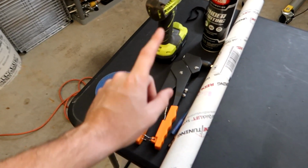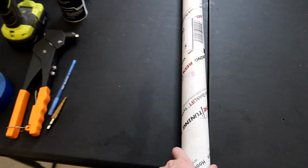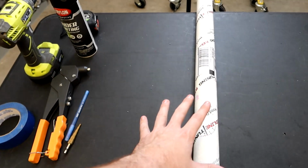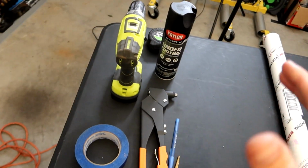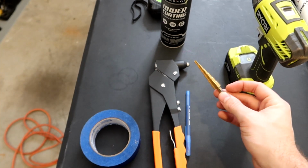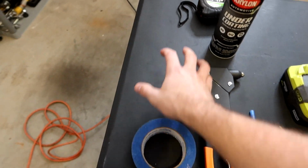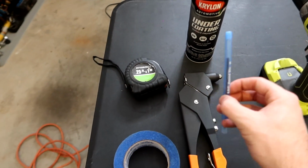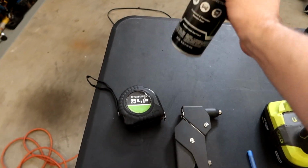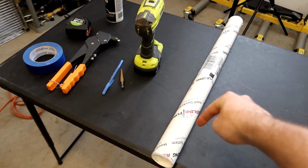So for the shocks, I bought the Redline Tuning shocks. I'll link them in the description down below. Tool wise, to install these shocks, I'll get into what all's in the kit here in a second, but tool wise, we're going to need a drill. We're going to need a 3/16 inch bit, which I have my little taper bit right here. We're gonna need a rivet gun, some masking tape, a tape measure, a pen or a Sharpie, and a little bit of automotive paint. So let's go ahead and open up the kit for the shocks.